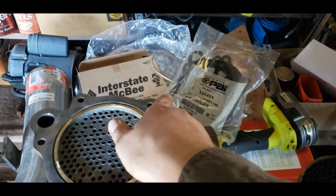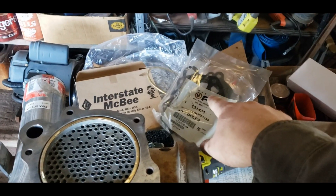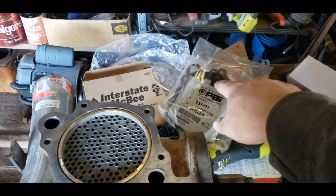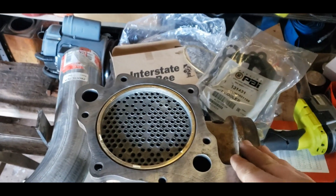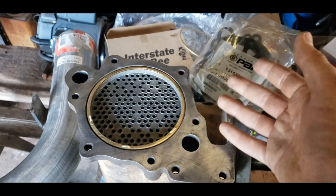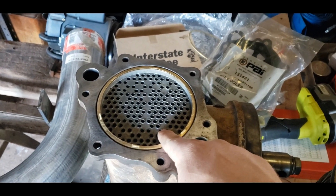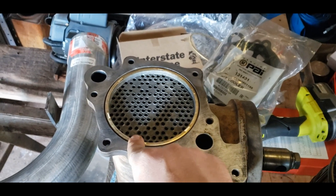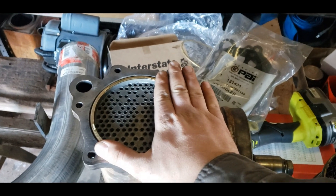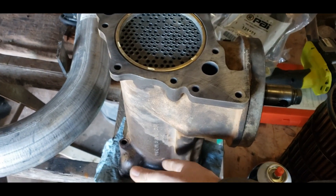The deformed ring is not what you want, so I was forced to open the second gasket kit I ordered. That ring fell right into place and I can still move it just slightly with my finger. I don't know which is more correct. The O-rings from that kit went in hard — I had to shove them in with a screwdriver, which you're probably not supposed to do, but I was gentle. The O-ring was tight, which is what you want because that's sealing the cooler core.